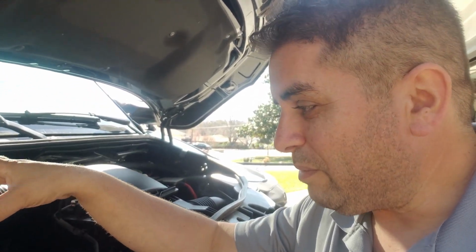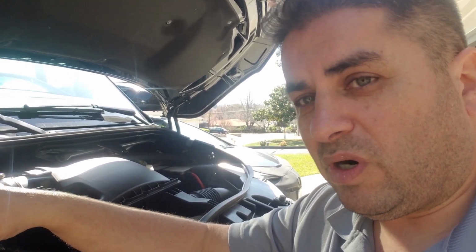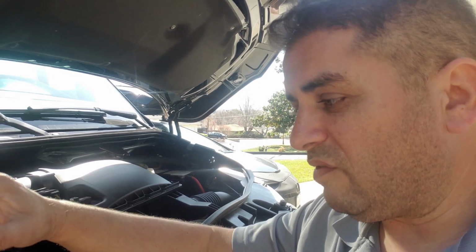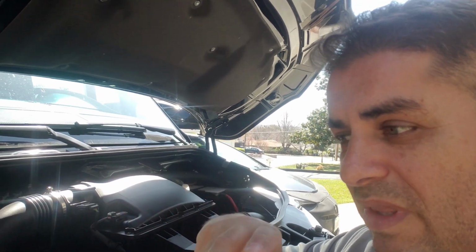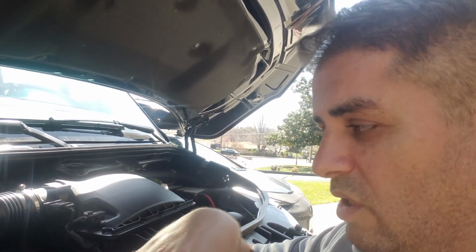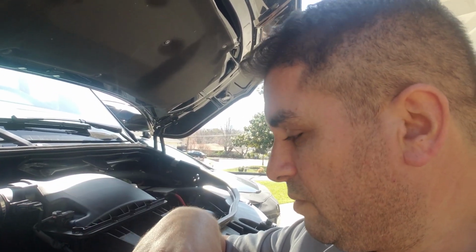And I know there's a bunch of people out there that are doing reviews and telling you guys to go with that 4-cylinder motor, because it's got similar horsepower and it's a little bit cheaper. But trust me, when you have a bigger van and RV, it's not about the horsepower, it's about torque. If you look at the graphs on how a diesel engine works and how it's able to create torque at very low RPMs, and you drive the two, you can see how much easier the diesel just accelerates and how much of a lesser load it actually has to go through.